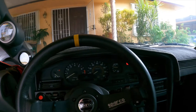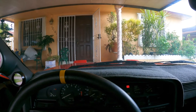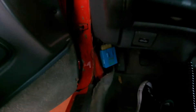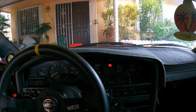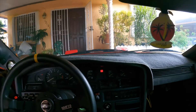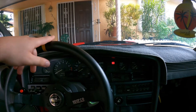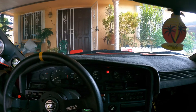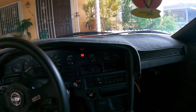Honestly, I'm happy with it for not having any of the planned stuff in here yet. Also, we put in a new retractor relay — we were stuck in an infinite cycle of up and down with the pop-up headlights. That issue is resolved for the most part, however the left one still doesn't go down, which leads me to believe maybe I installed the motor incorrectly initially. We'll check that out — let's get to the good stuff.